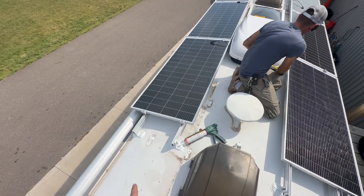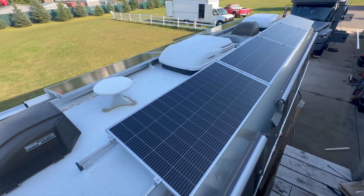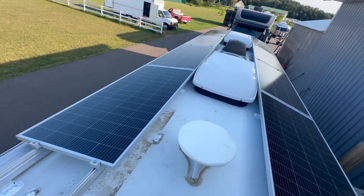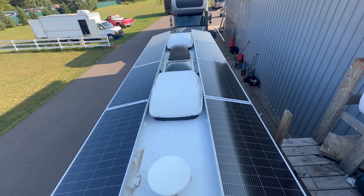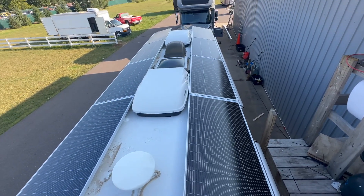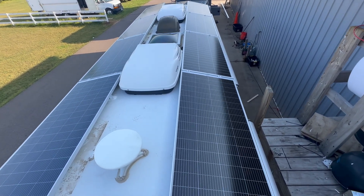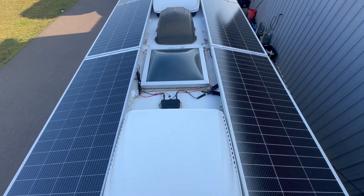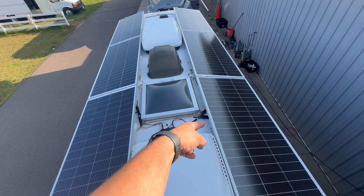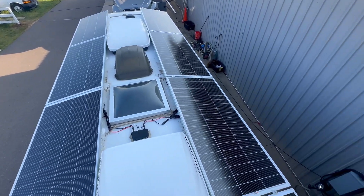JD's been hard at work and here it is — all done. End caps are on the rails and it looks really good. We're trying to convince more people to do this to their Airstreams; we think it's a really great way to go. If you know somebody who wants more solar on their Airstream, you know where to find us — link in the description. The wiring runs right in using SAE to MC4 adapters. We're not getting much solar right now because we're shaded by our shop, but the proof is in the pudding.